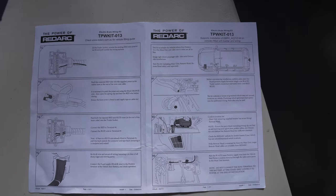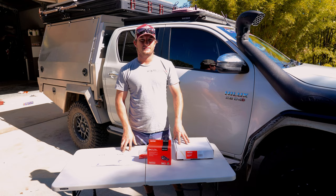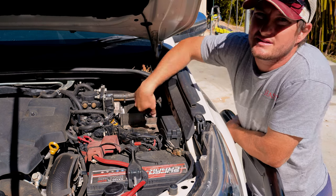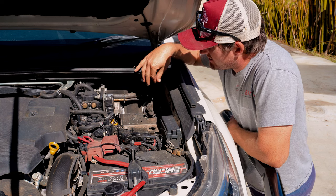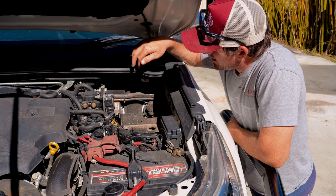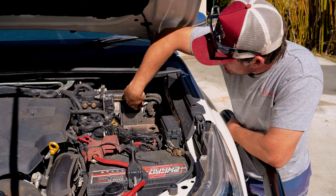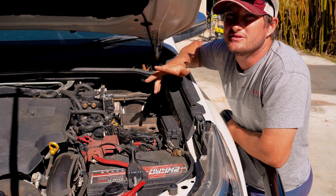So we've just got the generic wiring diagram to run off — it's pretty self-explanatory. We're going to start by running our power cable out of this grommet here behind the second battery, or where you would normally run the second battery. And then we're also going to pull our cable through that goes down to our trailer plug and follow the wiring harness for the trailer plug itself so it's all neat and tidy.